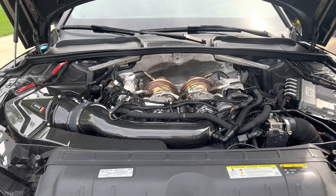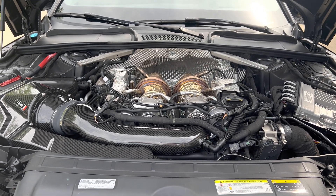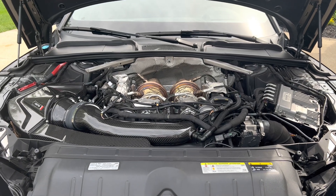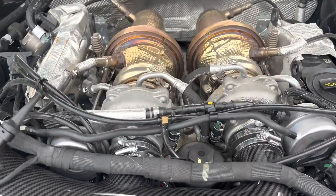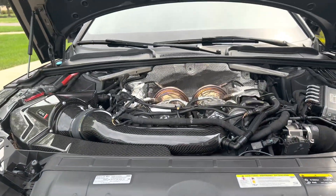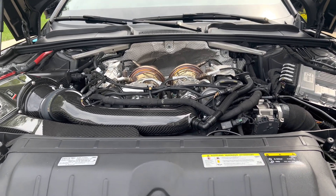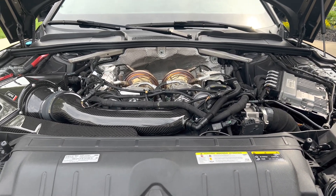There are two main benefits to this engine. It makes a turbocharged engine smaller because there's less piping, which also increases the efficiency of the motor. To further explain that — my previous Audi, the 2018 Audi S4 Prestige, was a 3-liter V6 with a single twin-scroll turbo on top, and it had a front-mount air-to-air intercooler. That one makes its peak torque at 1,370 RPM — really low — and it makes that torque all the way up until 4,500 RPM.